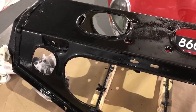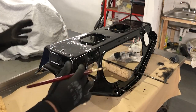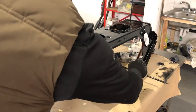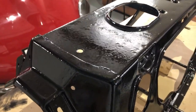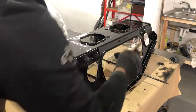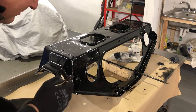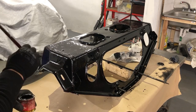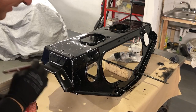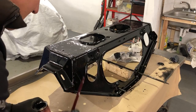It's now really beginning to look every bit as good as a powder coated frame, with I think better durability properties. This is going to set really nice and hard and be very durable for stone chips as well as for torsional stress through the subframe — obviously with the wishbones acting through here the frame will definitely twist, and I think that's where the weakness of a powder coated finish really comes in, as that powder coat can be subject to cracking, and if you get moisture behind the powder coat that's where it's really flawed. I'll just do a final few checks on this to make sure I don't have any drips or sags and that I've got really good coverage. I have to say I think it's looking absolutely fantastic now.